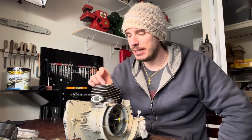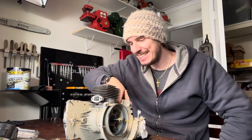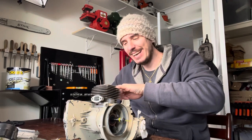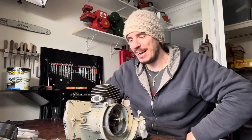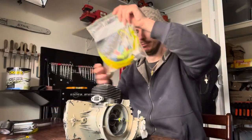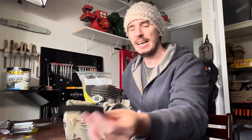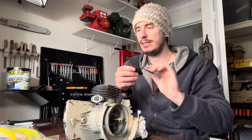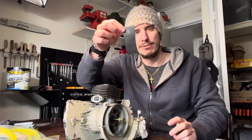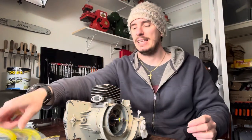The first thing we're going to do is basically block off the exhaust and block off the intake. Now we need to make sure one of those we can either extract or add air. I've actually got a kit here — it's a bag of things I've put together. I've got some inner tube, that's all that this is. I use one piece for pretty much every exhaust — you pop it on, slip it down between the two bolts, cinch it up and the exhaust is sealed.